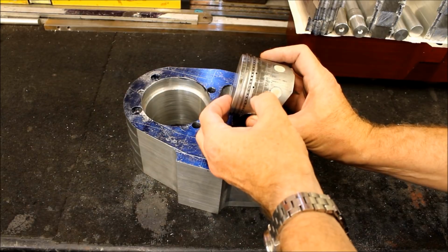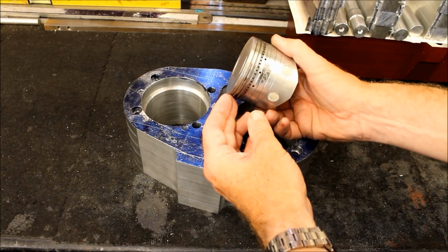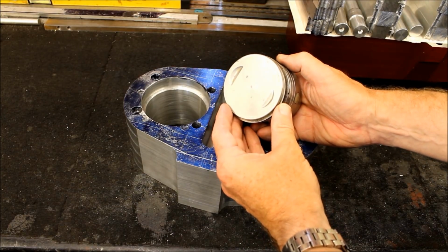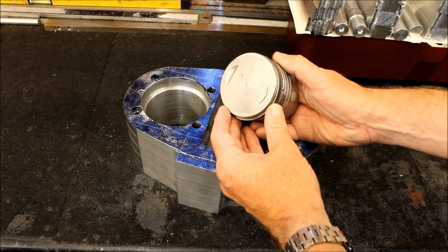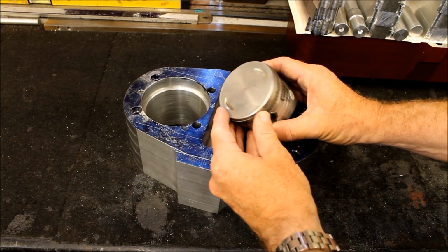Mind you, I don't know. It looks pretty bad to me. But, I don't know. There is 2. Anyway, these are off a Kawasaki apparently, a big bore Kawasaki Z, and they'll be mated with, what was it, an XS 1100 barrel, or rather sleeve, I should say. They're 72mm and the liners are 71.5.